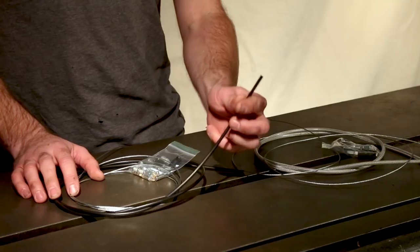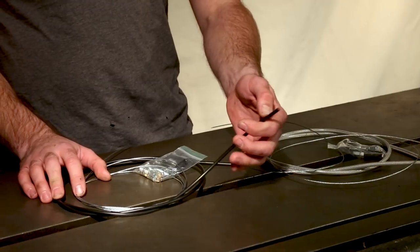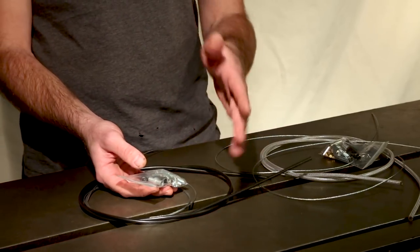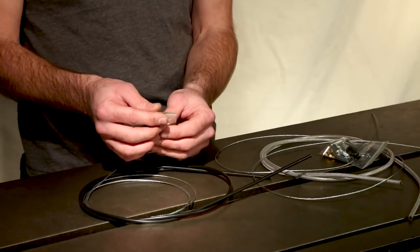If you're looking at something like a brake or a clutch cable, you're looking for stiffness, so those additional strands can cause problems and you don't want that small gauge wire — you need a larger wire. The outer housing is a five millimeter OD for the black housing and a six millimeter OD for the stainless braided housing. That makes sense because the housings are basically the same until you get to the covering — by adding the stainless braid and a plastic cover over the top, it adds an additional millimeter to the typical construction. The hardware bags are slightly different because the ferrules need to be sized correctly for the larger six millimeter wire versus the five millimeter outer housing.